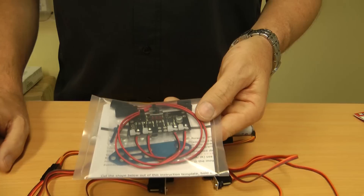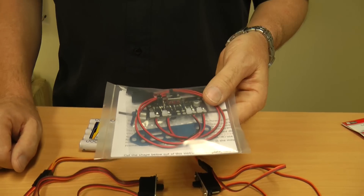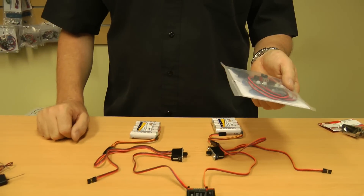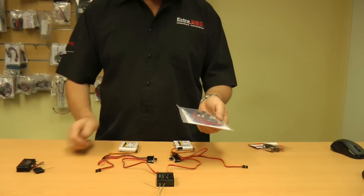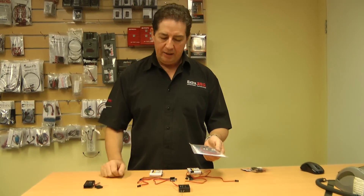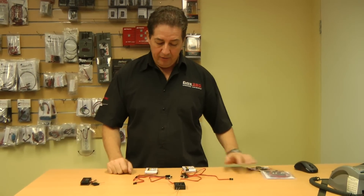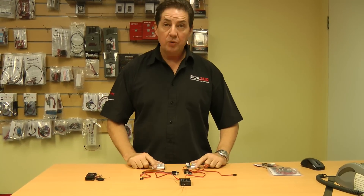On the point of battery balance, you'll get a few old wives' tales that one will completely drain the other battery — and this isn't so. If they're both of the same chemistry and same size, you can have one almost flat and the other one absolutely full, and you can sit it there until the cows come home and it won't charge the other battery. Don't believe that old wives' tale — it's not quite true. This system will save your aeroplane if you have an issue, and it's a wise way to go. See you next time.